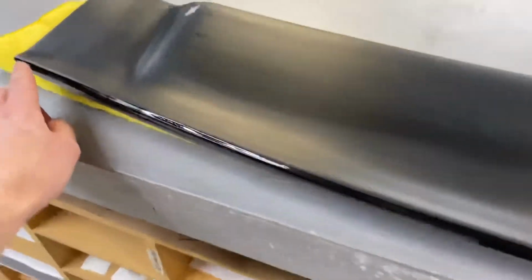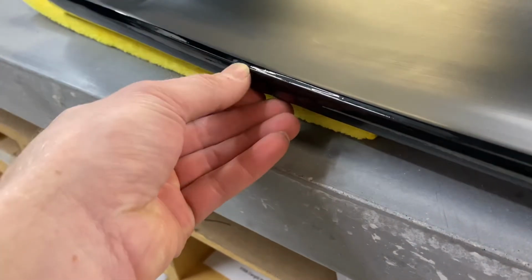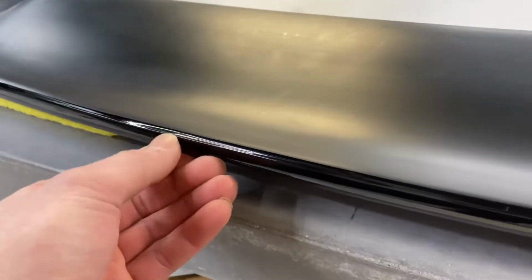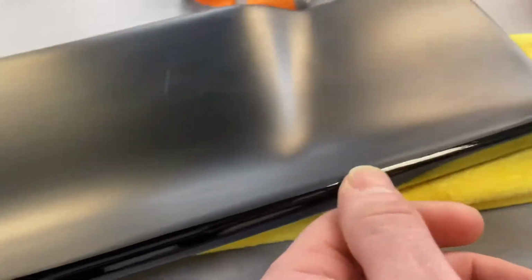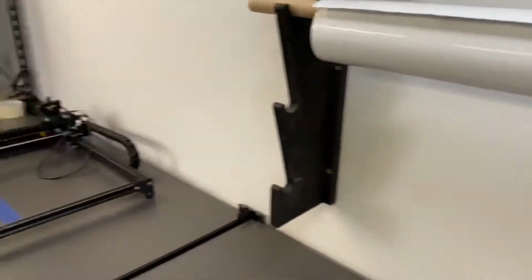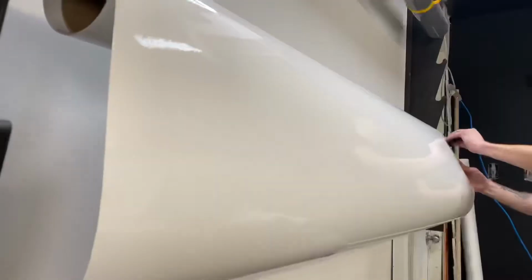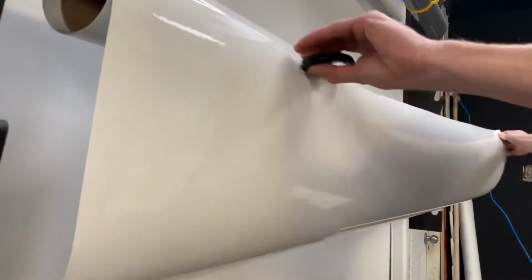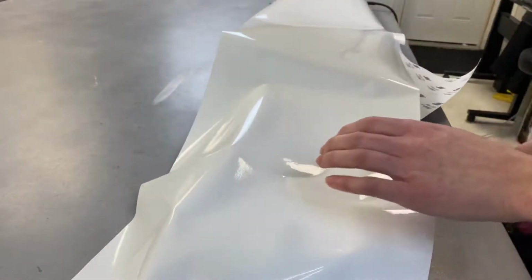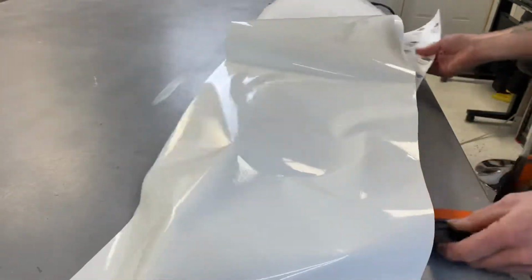So now we are going to start wrapping our white. We're gonna lay the knifeless tape along this edge again, but we're gonna lay it a little bit past this edge so we overlap this corner. So we're not on this seam, so we have another seam here. You'll only see one. It'll be nice and clean, I'll show you guys. We're gonna cut off a piece. We're gonna measure out what we need and then go another 2-3 inches because we do have this curve and because we want to wrap around a little bit. Get it tacked down.